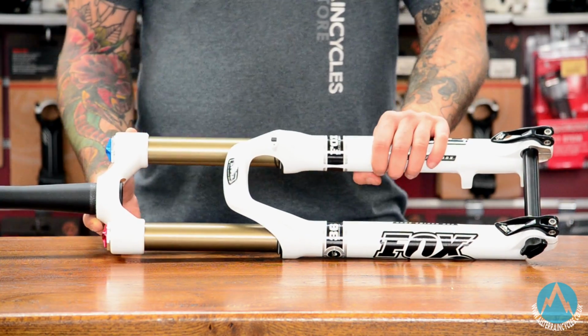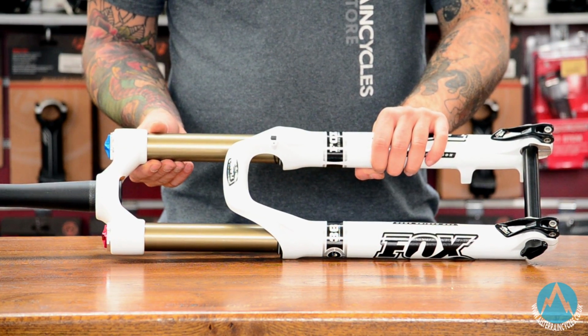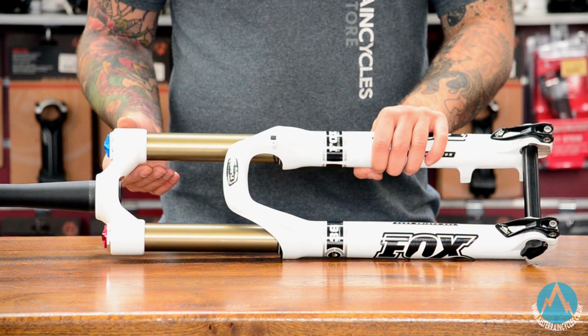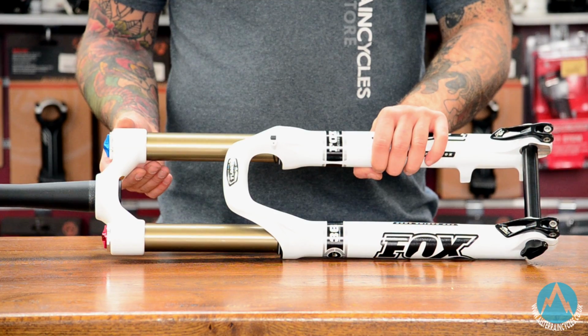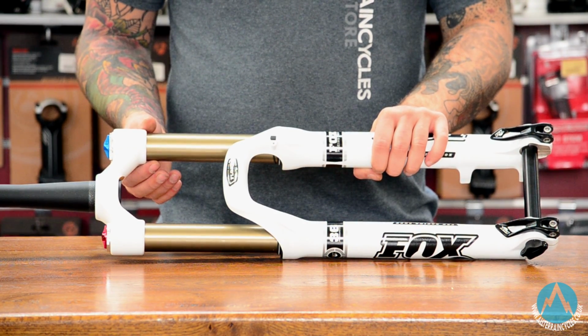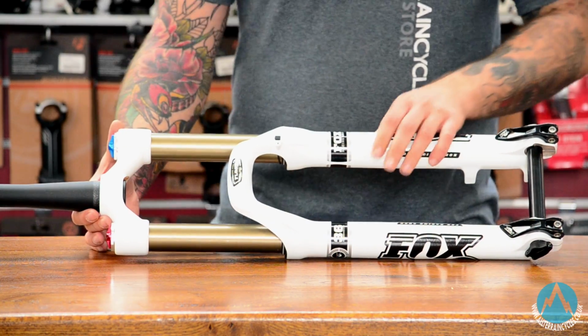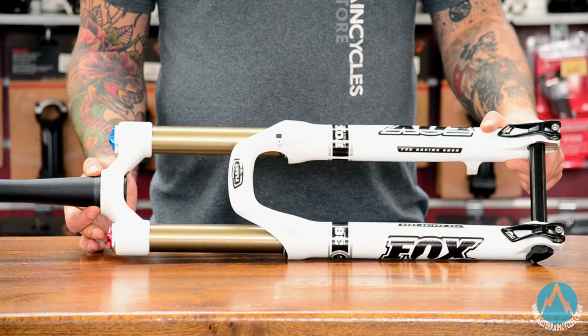The other thing is the stanchion size. 36mm stanchions and even 40mm is standard on the fork of this kind of travel. Rockshox still use a 40mm on their Totems, 36 on their Lyrics, and the Foxes use 36s all round for theirs. Other thing is tapered steerer is standard on these now.